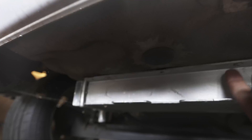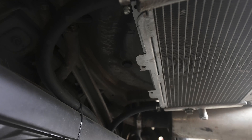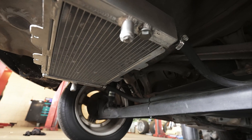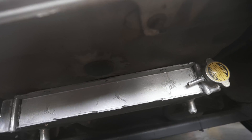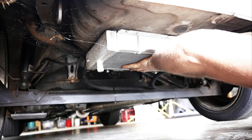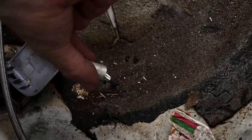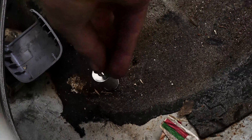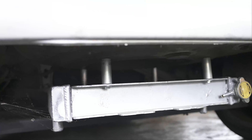We did have some overheating issues earlier. What we did was put a radiator - just off an ATV - under the back of the car and tech-screwed it straight to the floor. We've got aluminium pipes running underneath the car connecting to the heater inlet and outlet on the engine. No fans, nothing - just the extra water capacity and that extra radiator. We've already dropped engine temperatures by 10 degrees. We're thinking of putting 50mm spacers between the floor and the radiator and testing again, and if it's still overheating we might add a small fan.